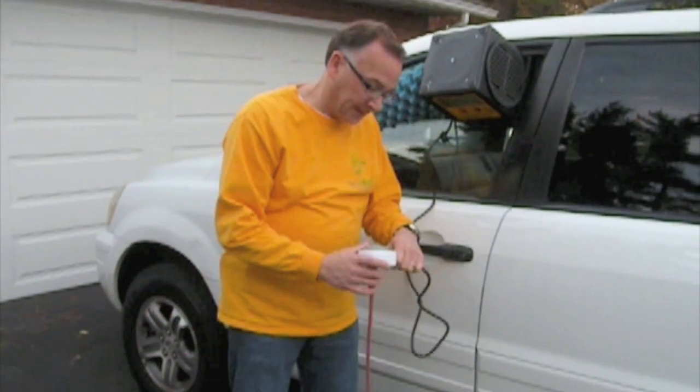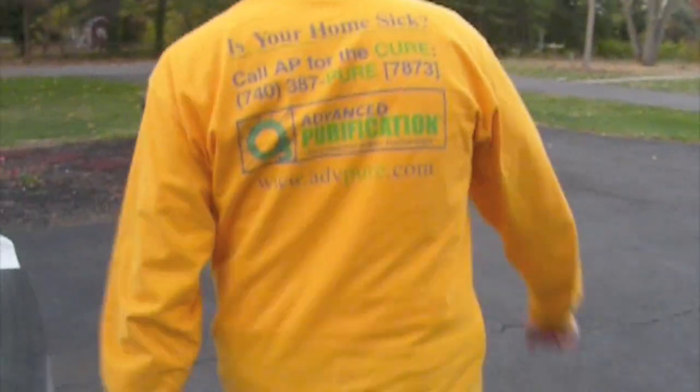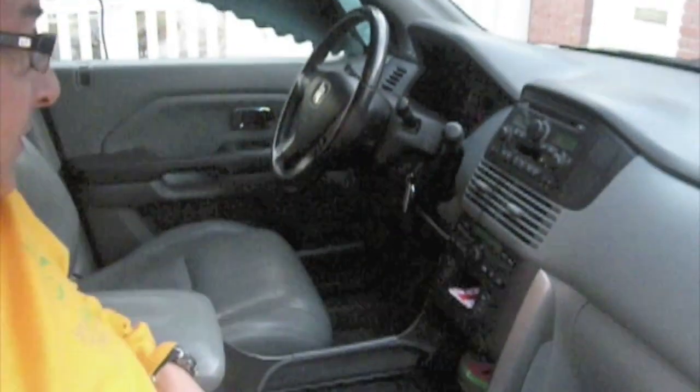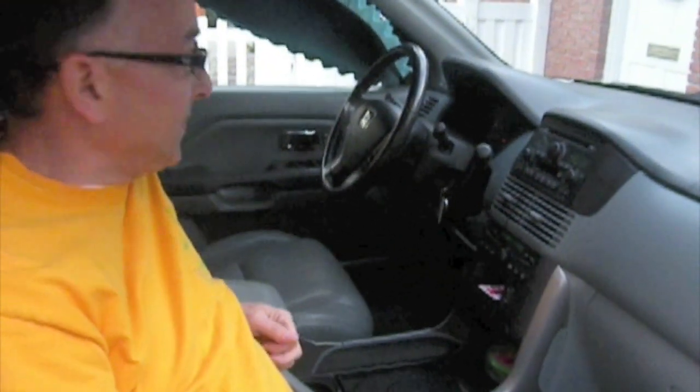Okay folks, we're back half an hour later, and the unit has turned off. We're going to go around to the other side to do the sniff test, which is the key to knowing whether we had success or not. Wow, that's a lot better — it smells great. Ultimately, with as little as half an hour of ozone at half the output — 7,000 milligrams per hour versus 14,000 — we fixed a pretty serious smoke issue. It was pretty potent. So ultimately, you've got a new-smelling car with 100,000 miles on it that smelled to high heaven from the previous owner.